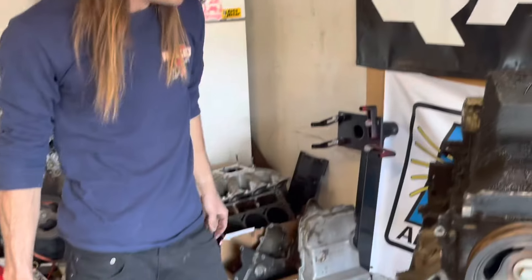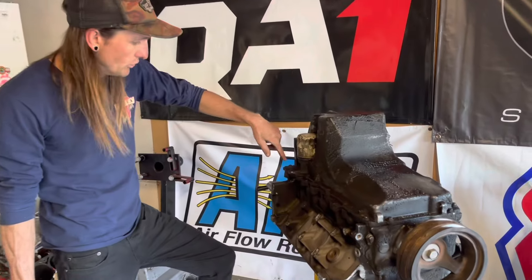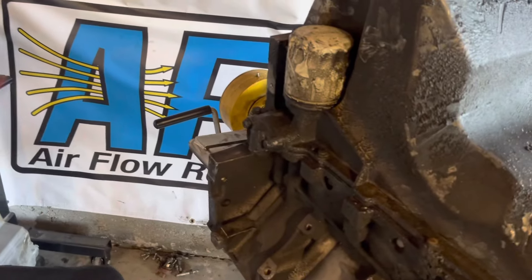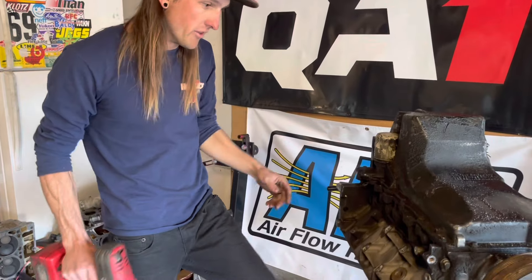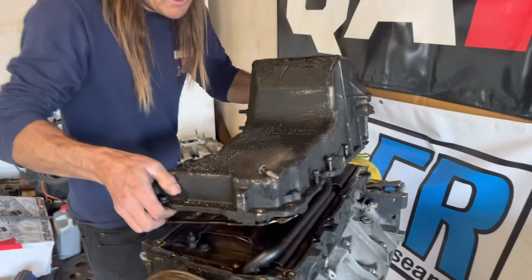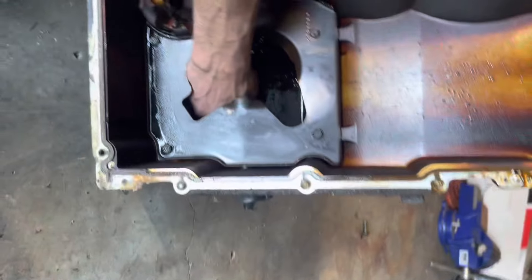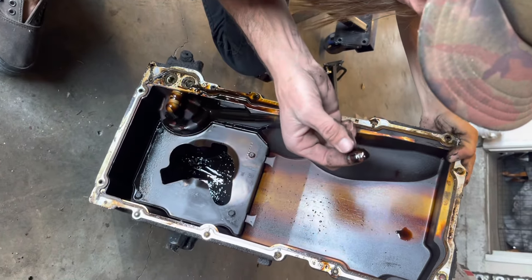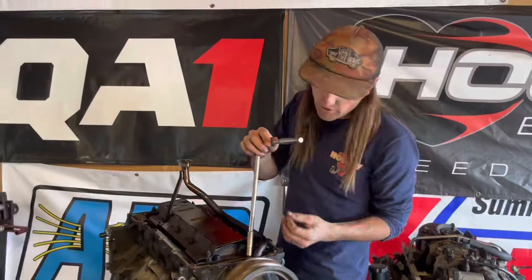Let's throw this on the yellow stand, flipped upside down, and throw the pan off. One thing I actually like — this is one of the first engines I've had in a while that actually has the block-off or just the loop. It seems like every engine we've been pulling — all the later 5.3s or the three-quarter ton 6.0s — they all have the oil cooler lines. The pan isn't very tight, doesn't have to get pried off. This is a half-ton truck engine, it might not be as worked as the three-quarter tons, and the oil is dark but not bad — dark just means it did its job.